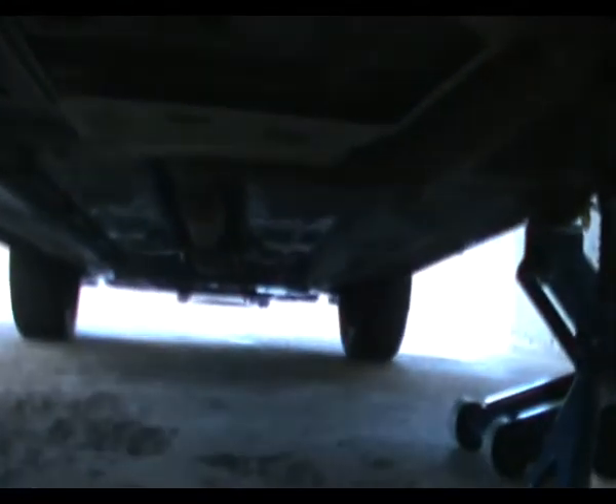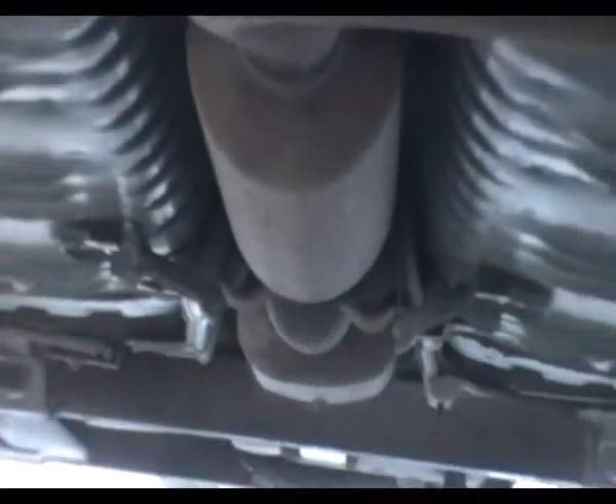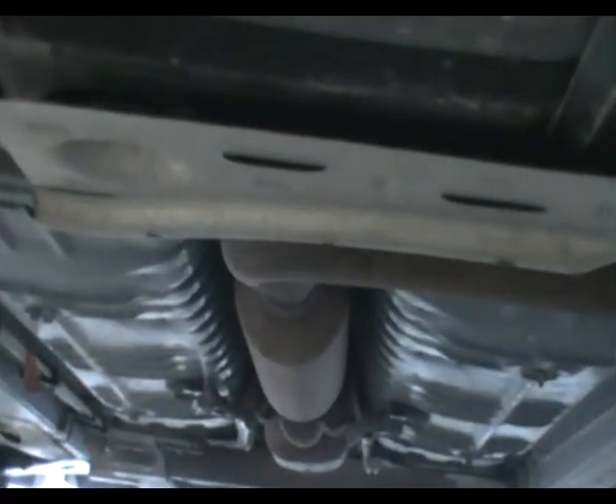There's another rubber connection down there — that's another rubber hooked up to it. We're going to remove these two on each side, and there's another one somewhere down here. What ends up happening is this entire pipe system will lower down to the ground, allowing us to weld right here, especially from this side. You've got to make sure you have a tight seal — if you don't, the exhaust will escape and the engine will sound loud even with a new muffler. It has to be airtight.